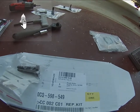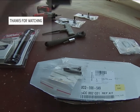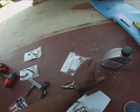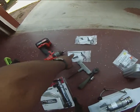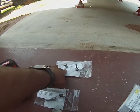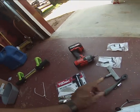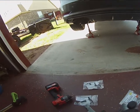Here is the part number and all the good stuff. It came with two 10-millimeter screws that hold it in. We bought the kit, so it came with some extra o-rings, two more screws, the actual Haldex fluid, a new drain plug which is an 8-millimeter, and a fill plug which is a 5-millimeter. We also bought a multi-purpose pump to transfer the fluid into the pump itself.